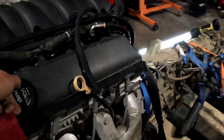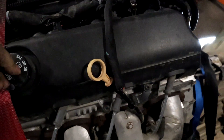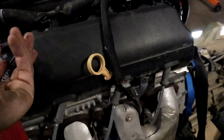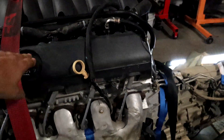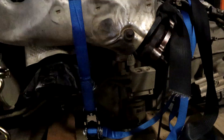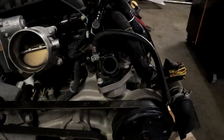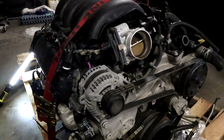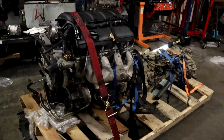Another thing to check for when you buy a used engine — I'll open it up here. Usually you can see a rocker and see how clean it is. I'm always looking for sludge, but that's usually only on the older engines, Gen 3s with tons of miles. These run synthetic-only oil, so they're usually mint. Pull the dipstick out and make sure there are no metal speckles on it. If the filter is still on and not damaged, pull the filter off, pour it into a pan, and hopefully the oil comes out clean — seeing speckles means it's hosed. Then, of course, rotate the engine over and make sure it's not seized. This is just a standard dropout engine and the things to look for.